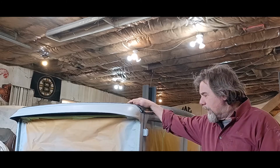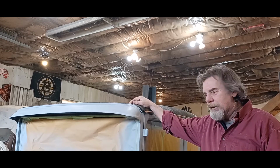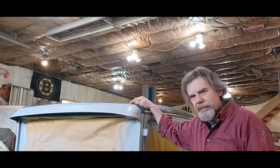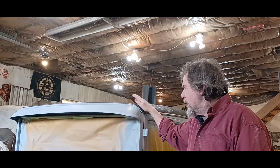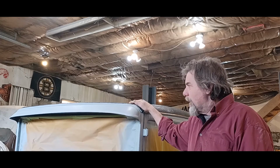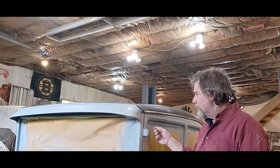Okay, so a couple hours it took, I sanded the whole car. Nothing jumped out at me as being weird or funky or anything like that. So I'm calling it paint ready. I've got a mask off the roof, of course, and I'm gonna recover my windows. The reason for that is I don't want any of this gray primer, maybe a little flake or speck, to come off of it while I'm spraying and end up in the paint. This car is going to be black, so we don't want anything in the paint.